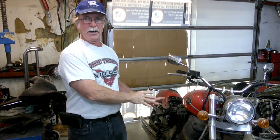Now, I was just going to sell the bike and get rid of it cheap, let it go down the road, but, well, I got this infection in my brain called a conscience. And I can't sell a bike in good conscience knowing somebody's only going to ride it for a few thousand miles and get stranded somewhere because that damaged shaft is going to spin and destroy the splines on the new sprocket as well. It's not going to last. So I knew it was really a temporary fix, if nothing else.